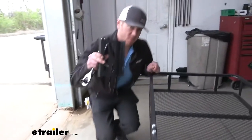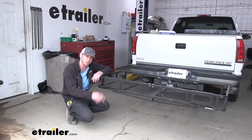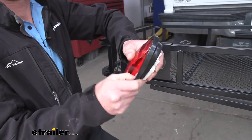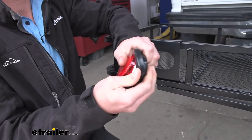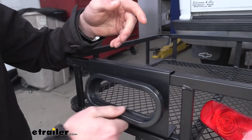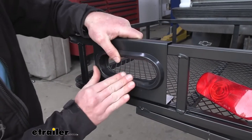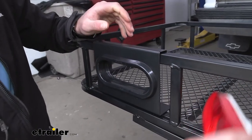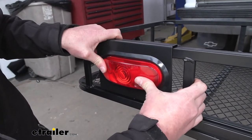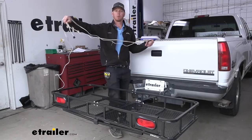Once that side's done, it's the same exact process on the other side. Now that the brackets are nice and mounted up, we're ready for some lights. We're going to take our lights and remove this rubber grommet — all we have to do is just pull it off one way and it should slide right on out. Make sure the words are upright, then slide the grommet in and push it so it seats in there. Then take the light, make sure the words are upright again, put it in there and give it a little pressure until that little tab snaps in.